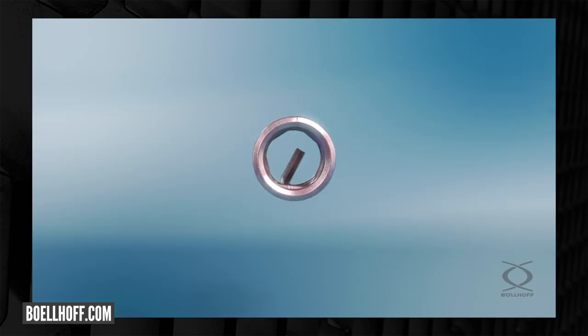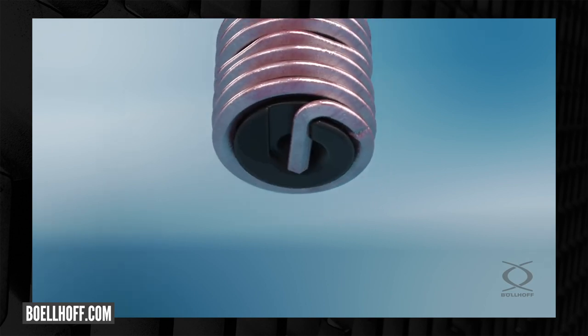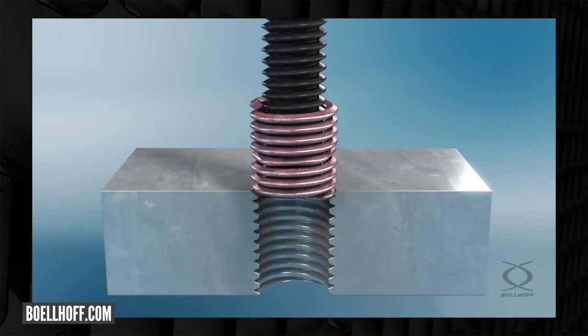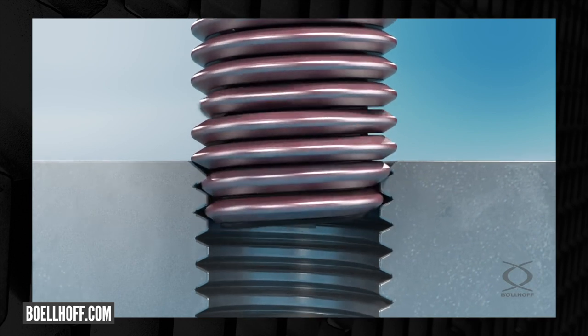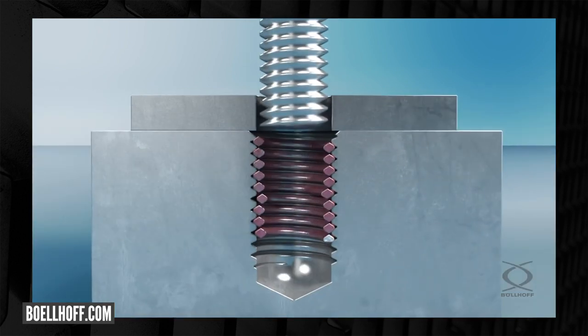And what to do if you've completely removed all of the thread? When damaged to a lesser extent, sometimes they can just be cleaned out with a tap. Often though, you won't be so lucky. Losing all the thread or damaging them beyond repair is a common problem with cranksets. In my experience, running a pedal with washers helps prevent this. If, however, you're already up a certain kind of creek without a paddle, you might be reaching for something to rectify the damage: a helicoil. A helicoil is a simple device where you drill out the original hole to increase its size slightly and tap it with a thread. You then fit a coil, or in some cases insert a tube that has thread on both the outside and the inside. You fit this coil using an external thread directly into the crank, then apply a good dollop of threadlock and leave it to set overnight, like a prize-winning blancmange, before reinstalling your pedals.